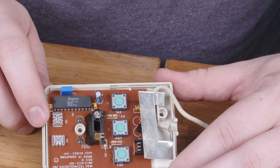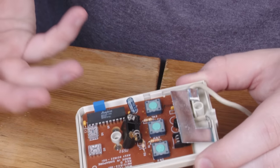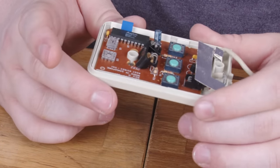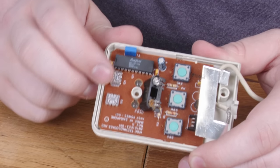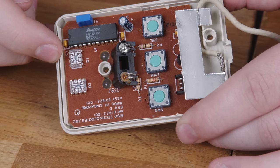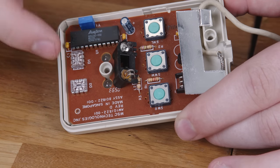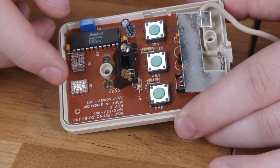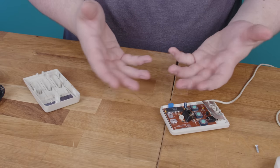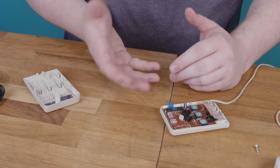These are not CCD image sensors — they don't generate a complete image. They're basically simple photo detectors, a type of device that produces a voltage based on how much light is hitting it. You can tell immediately that they have an orientation — one is obviously horizontal and one is clearly vertical. This starts to hint at how the device works: clearly one handles horizontal movement and one handles vertical movement. Since each one gets light from one of the two LEDs, that means one gets red light and one gets infrared light, which seems kind of weird.